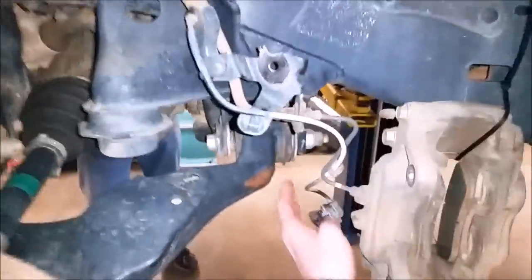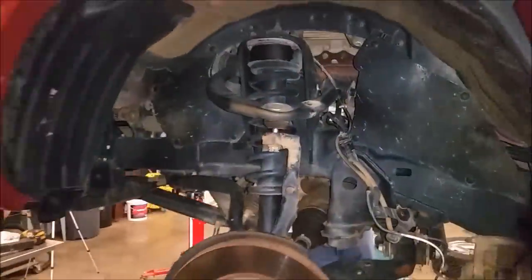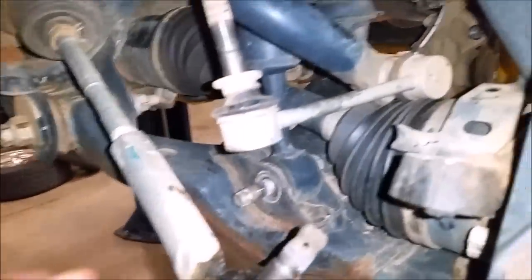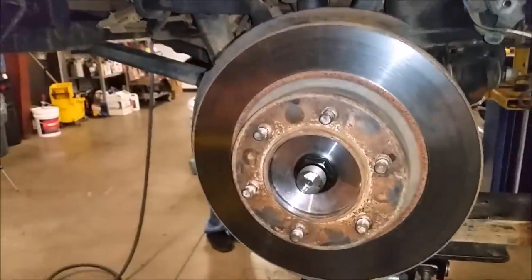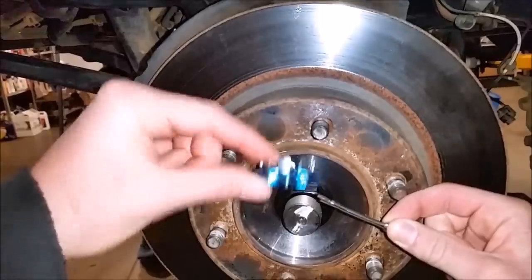With the caliper out of the way, we've gone ahead and unplugged the ABS switch right on the back side of the caliper. Now we'll go ahead and remove this part right there from the upper control arm. Now we're working on moving the strut — we have the bolt right here and then three bolts up on top of the strut. With the hub cap off, you're going to go ahead and remove the pin that's on it, and then you'll be taking this piece right off.